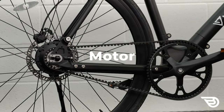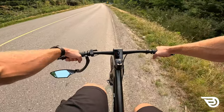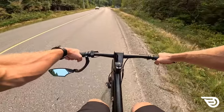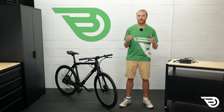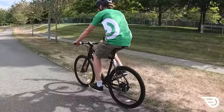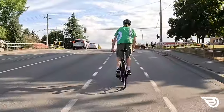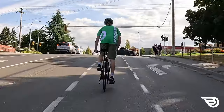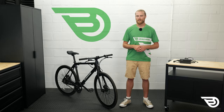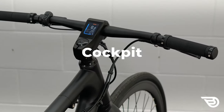Now let's take a look at the motor. The 350-watt rear hub motor seems to be undersized for the unit. While it gives it a good shot, the issue is that the motor simply lacks the power and torque to efficiently climb hills without the assistance of a traditional geared drivetrain. While the tuning means initial rides will be peppy, the bike becomes disappointing over distances as the motor quickly loses the initial pep as the battery voltage drops. Overall, performance was similar to other bikes in the same genre and motor size. On flat ground and mellow hills the bike operates just fine, but when you hit a serious incline you can find the bike's limits quickly.